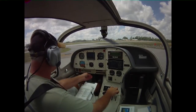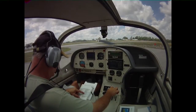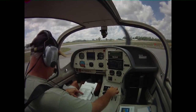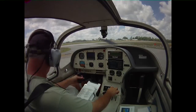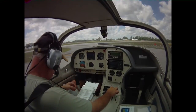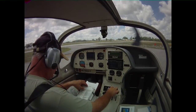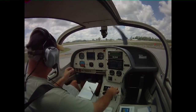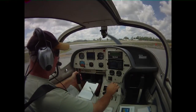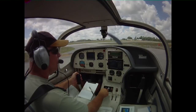Brakes. Fuel pump, auxiliary on. Flaps up. Doors closed, harness tight. Engine instruments check. Controls check — flight controls coming around, checking everything even, checking the flaps are in the up position. Flight City traffic, 159 Hotel Romeo is taking the active runway 1-0 for a 15-minute test flight.